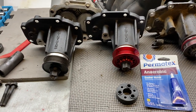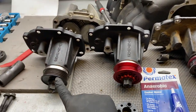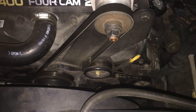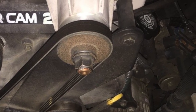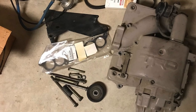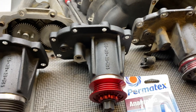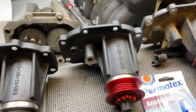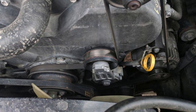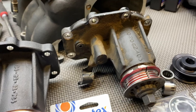The pulleys are red on some and black on one — the red ones are URD pulleys and the black one is a stock Toyota or TRD pulley; the color itself isn't significant beyond that. We also noticed this mounting hole, which originally mounted the static tensioner that came on early model superchargers — the first-gen gray top and even some early second-gen black top superchargers. Toyota eventually moved to a dynamic tensioner and updated the casting, so they no longer needed this mounting point and closed it off.